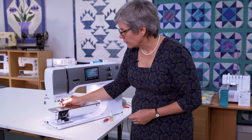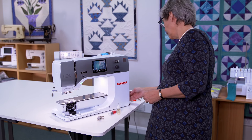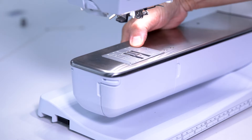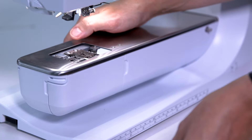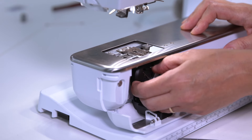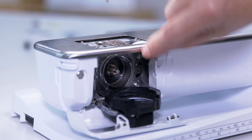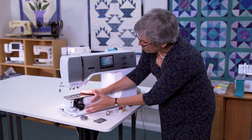We're now going to dismantle the machine. We're going to remove our presser foot, ensure that our feed dogs are in the lowest position and unlocked, and then we're going to remove the needle, then the needle plate — and you can see within there any debris that may have built up in recent sewing. I'm going to remove the bobbin case with the bobbin in, take the bobbin out, and then drop the race forward and remove the hook. So now everything is there ready for us to clean.